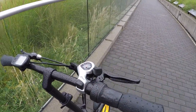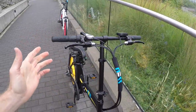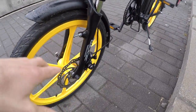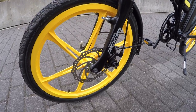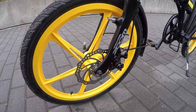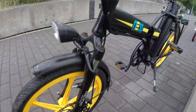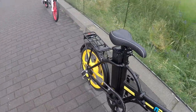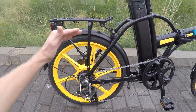Because these are mechanical brakes, the levers aren't adjustable reach. Again, 160 millimeters is a little standard or smaller — not mountain bike size. Everyone's trying to go bigger and hydraulic, but keep in mind the diameter of these wheels is smaller. You don't need huge brakes to stop them, and you don't need a super powerful motor — especially a hub motor — to have mechanical advantage because it's turning a smaller wheel. Same logic applies to the gear range.